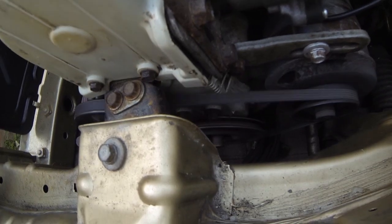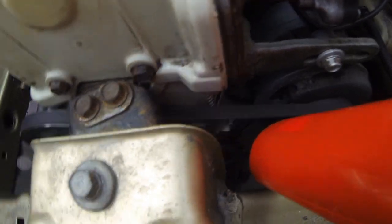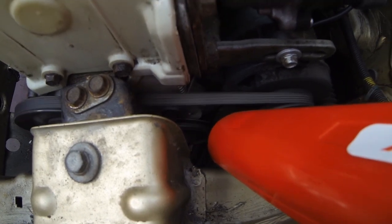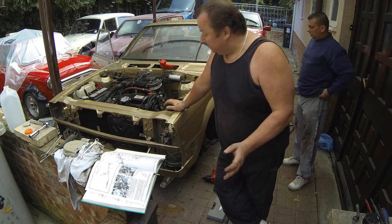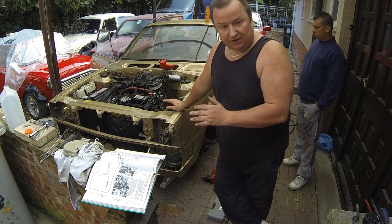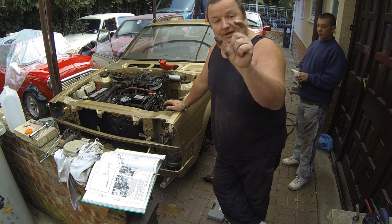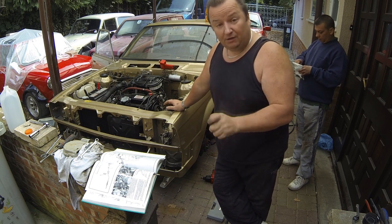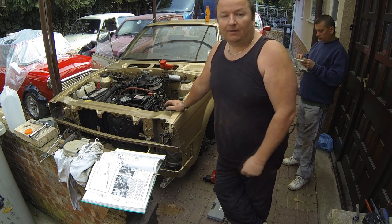That might be just the sticky start - just turn on. Push the choke in a little bit, it's ticking over too fast. Right, we've come against a little bit of a hiccup. Although it starts up and runs lovely, whilst doing the timing I couldn't line the timing marks up. So we tried taking the distributor out in case I put it in on the wrong spline - we've basically got everything correct with ignition timing so that's not the problem. The timing marks are about that far away from the actual timing point but the engine's running lovely.